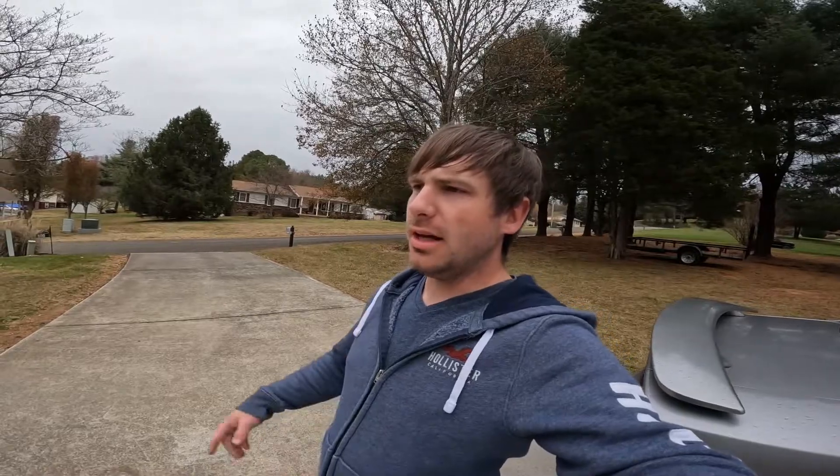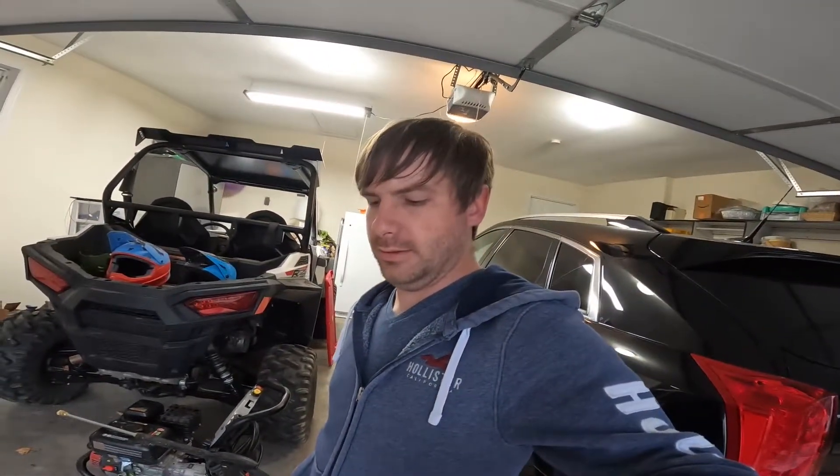What's up everybody? Welcome back. Hope everybody's having a wonderful Thanksgiving today. I was watching Nate ride his bike earlier and it started bogging down and started smelling like gas. I'm really not sure what's going on with it. We're going to pull it apart and see — clean the air filter, check the carb, might have to adjust the carburetor. We'll check for a fuel filter and maybe put a new spark plug in it. It shouldn't be too complicated. Let's jump into it.